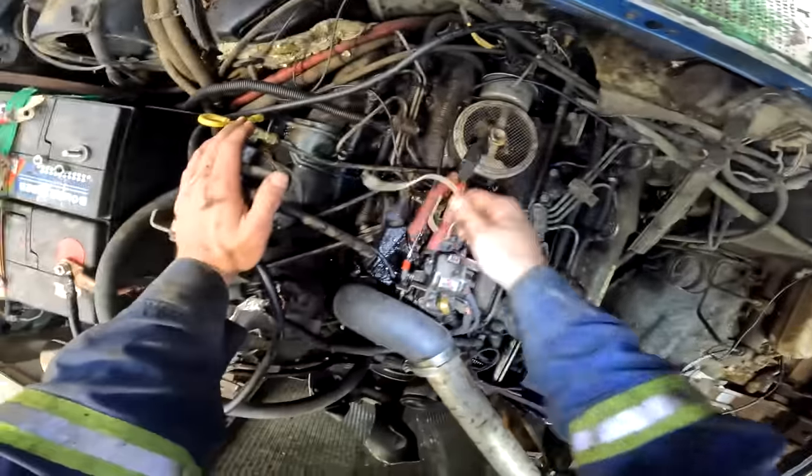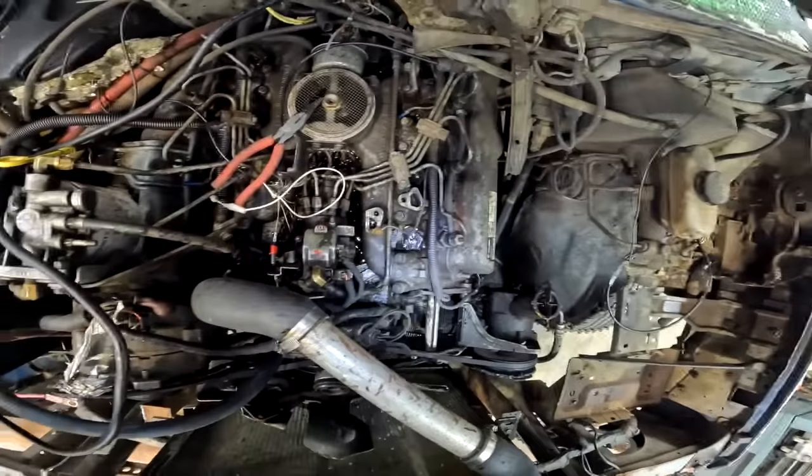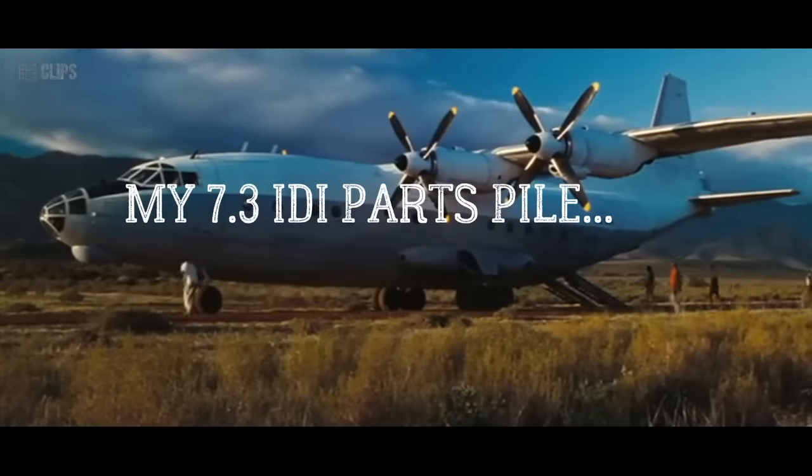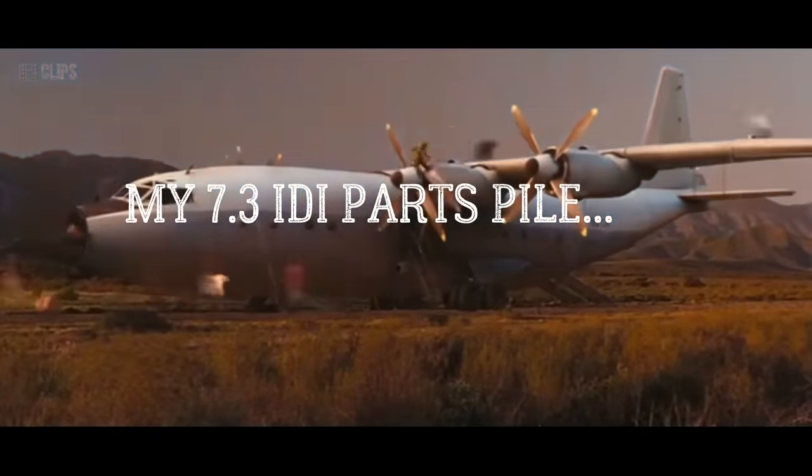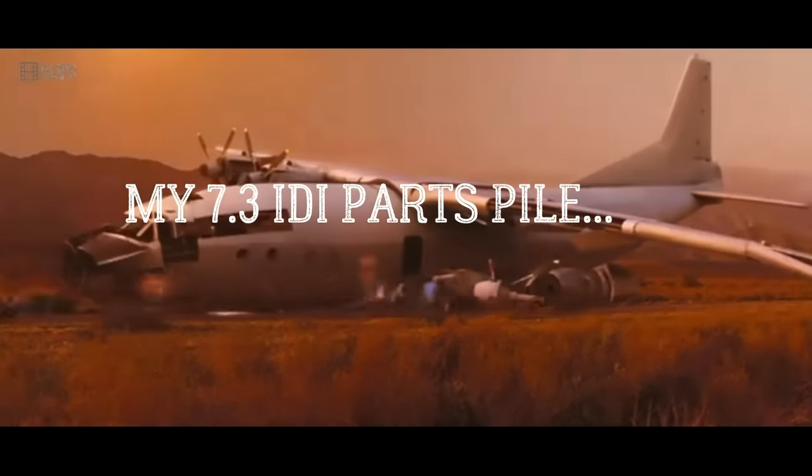So we'll pull the glow plugs out of it and see if we can't scrounge up some better ones. Alrighty, meow. So I had an old 7.3 IDI out of my wheelie and garbage truck that I had laying in the sea can. So I went and tested all our glow plugs and grabbed the ones that were still working. All right, we got 5 brand new glow plugs going in the Slave Lake.